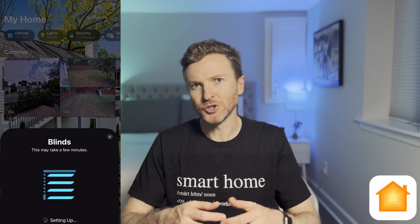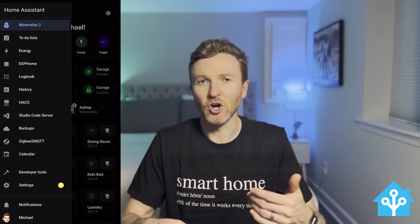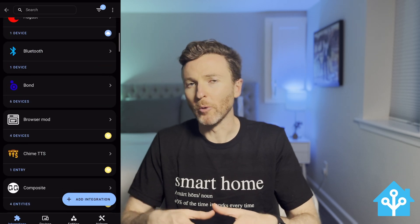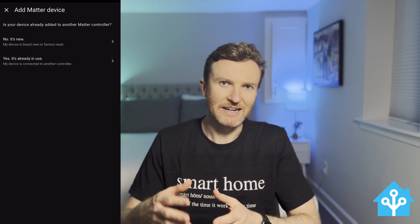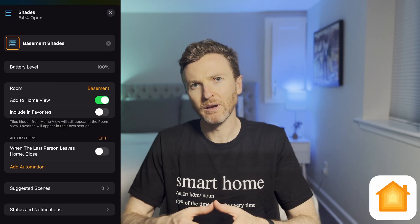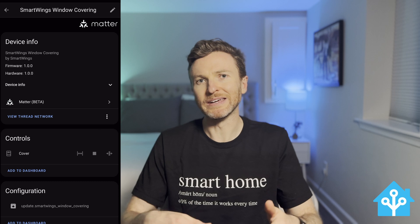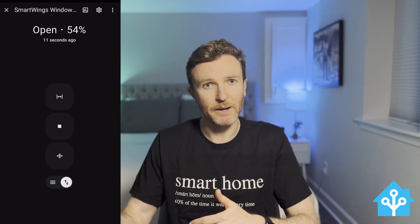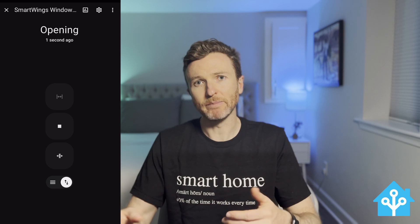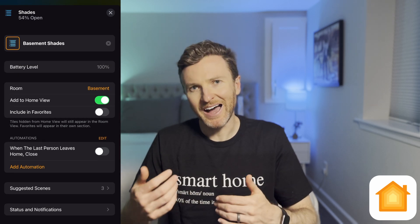I first added the shade to Apple HomeKit. To do this, just open the Apple Home app, choose Add Accessory, scan the setup code printed on the shade, and it's ready to use in Apple Home. Then I added it to Home Assistant — go to Settings, Devices and Services, open the Matter Integration, click Devices, then Add Device. Since I already added the shade to Apple Home, I selected 'Yes, it's already in use,' then clicked Apple Home. From there, I found the shade in the Apple Home app, clicked the Settings icon, and chose Turn on Pairing Mode. Just copy and paste that code into Home Assistant and click Add Device. Now I can control my shade using either the Apple Home or Home Assistant app, or with voice using Siri. From either app, just tap once to open or close the shade, or partially open or close it, choosing any desired position. You can also see the battery percentage of the shade's motor from either app, which is really helpful.